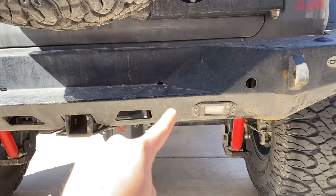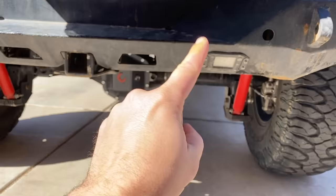Another thing about this bumper — it did have pod lights in the bumper to help illuminate when you're reversing, I like that. But there's a problem with having giant pods in your bumper: it makes your bumper way too thick. The reason having a really big bumper is not beneficial is because you're going to hit it a lot more. Yes, it's supposed to take hits, but you want to minimize hits as much as possible — it prolongs the life of your bumper. You want something strong and thin, tight to the Jeep. Instead of giant pod lights they could have used some sort of flat floodlight LED, but they just rushed it out.